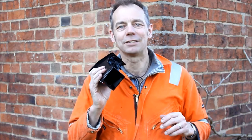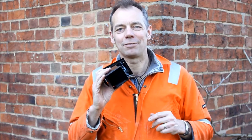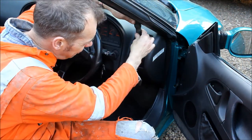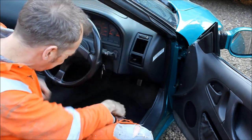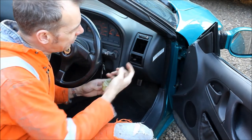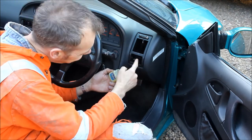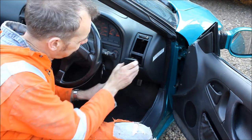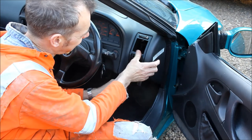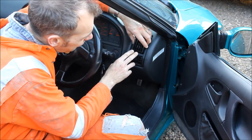The main thing we've learned from 12 months of making these videos is that you're peeing in the wind trying to film a fiddly job like that inside a dark hole — but I'm sure you can figure out sticking a bit of fabric onto a bit of plastic for yourselves. Just put it back on the opposite of how we took it off, then lubricate the pivots of the vents with a little bit of Vaseline, and push the vents back in.